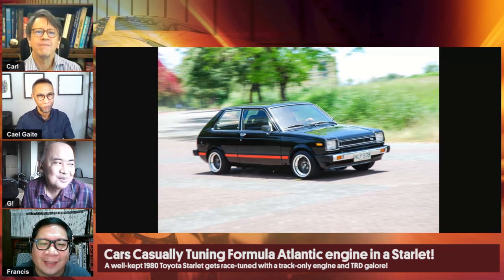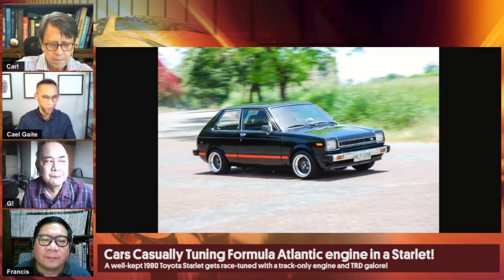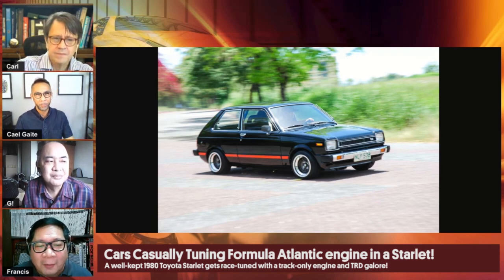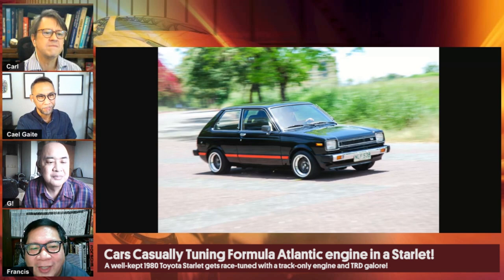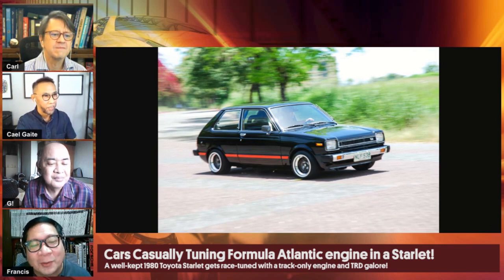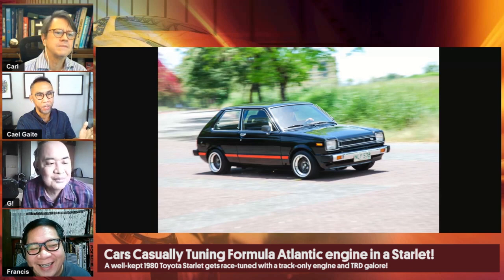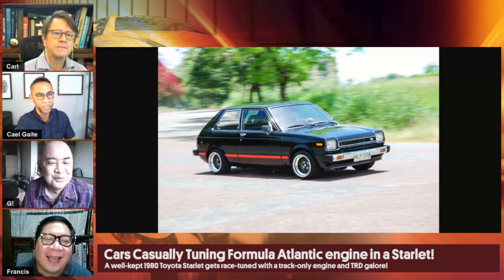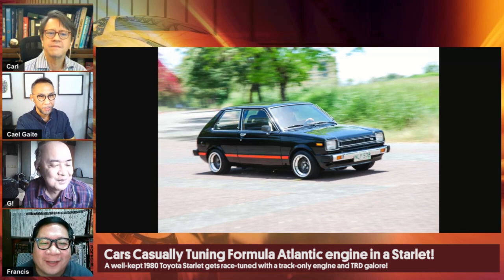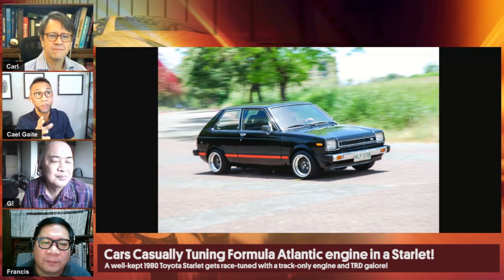The car looked really good. Because it was short wheelbase, you could put a big motor in a short wheelbase. It was a perfect recipe for slalom. Remember the 3K Stage 3 where it wasn't slanted anymore? Oh right, yeah, the 3K-E, nakatayo siya. Nakatayo na, di ba? And it revved to almost 9,000 RPM, a super high-revving engine. Yeah, that K engine is one tough motor. And the difference in that motor was it was a cross flow head.